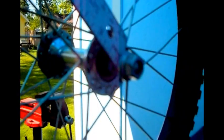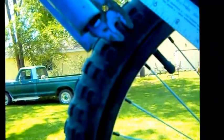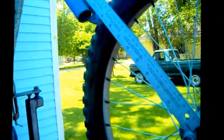This is how I find this measurement. We're on top of the axle here. Sorry about the camera not focusing — it ain't going to work on the macro setting. It's nine and a half inches. I'm going to go ten, maybe a little more. That means I have to add ten inches to this piece when it's put on. There's a difference in these bottom dropout parts — some of them don't go over the bottom of the pipe. I kind of like the ones that go over the bottom of the pipe because they're easier to put on. So I'll be adding ten inches to this.